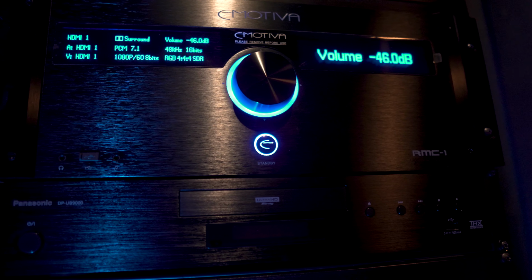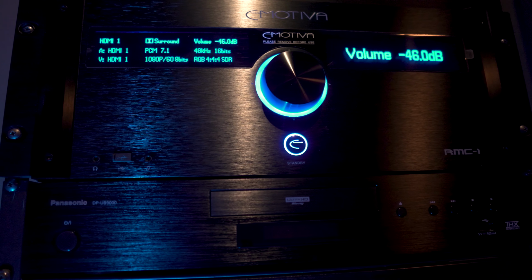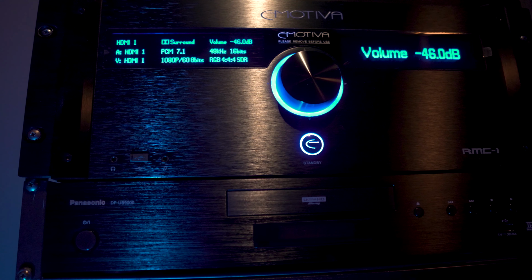The only issues that I've been having is using the main HDMI out to my projector and having Zone 2 go to another TV at the same time. The signal would at times cut in and out, and other times it could catch and work perfectly fine. I narrowed it down and found that I was having a handshake issue with the television. Yes, I tried different cables and all that too. Now, to be fair, I've never had a receiver or a pre-pro not give me the same problems. The positive thing is that the Emotiva would actually occasionally work fine, but for the most part, I would have to yank HDMI Zone 2 out.